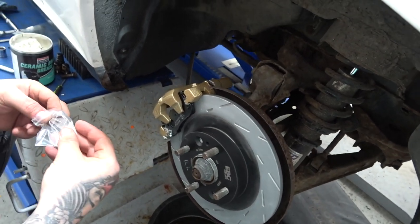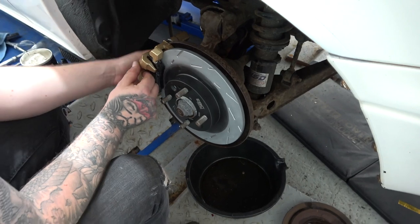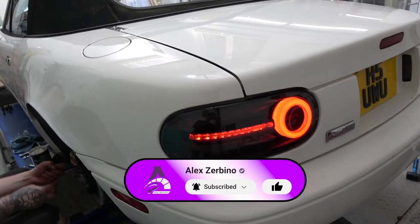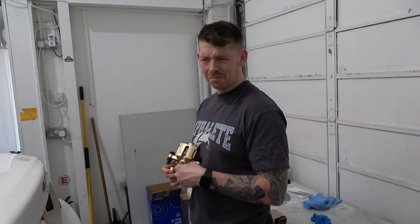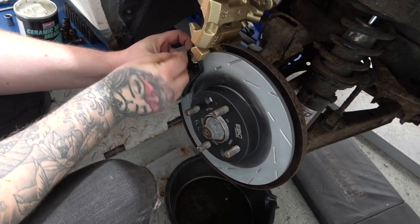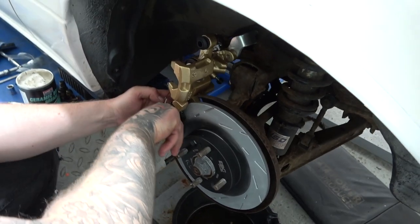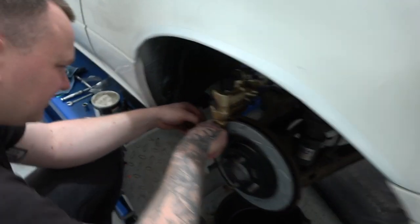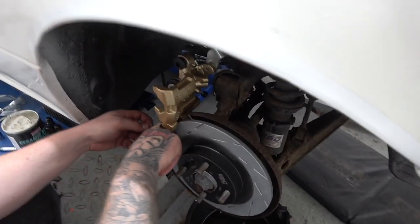Fitting the W-springs - there's a third one in there somewhere. These anti-rattle springs are going across the workshop. Trying to figure out if the brakes are on - if anyone watching knows why the rear lights are on when the brake pedal is depressed without the ignition, that's the only thing we could think of. Going to try putting the springs on after putting the caliper on. Also being careful not to stand on the brake caliper or get brake cleaner on the painted surfaces - saw a little bit of gold flake come off.